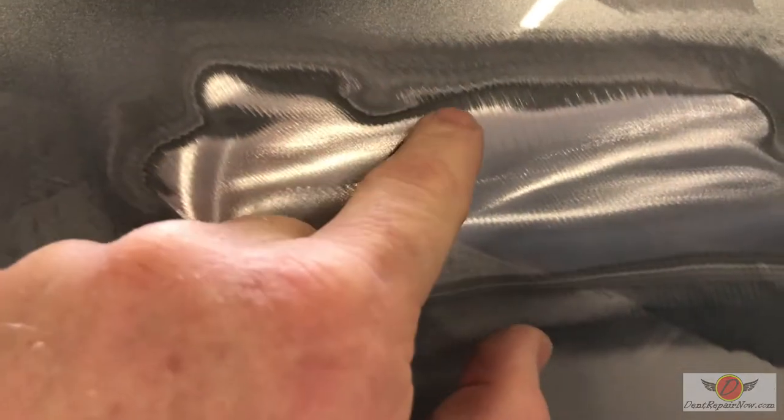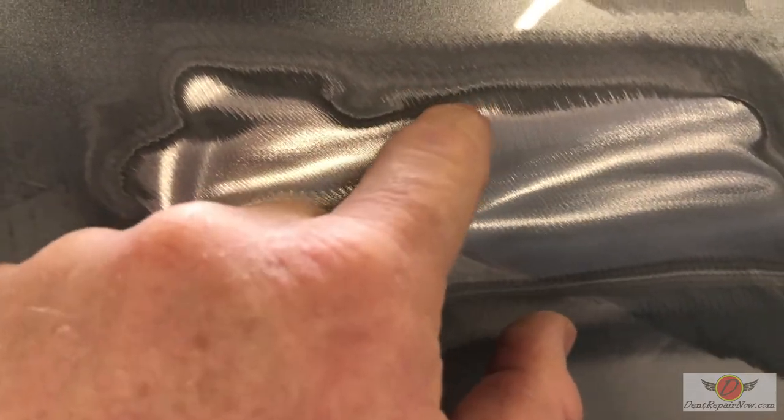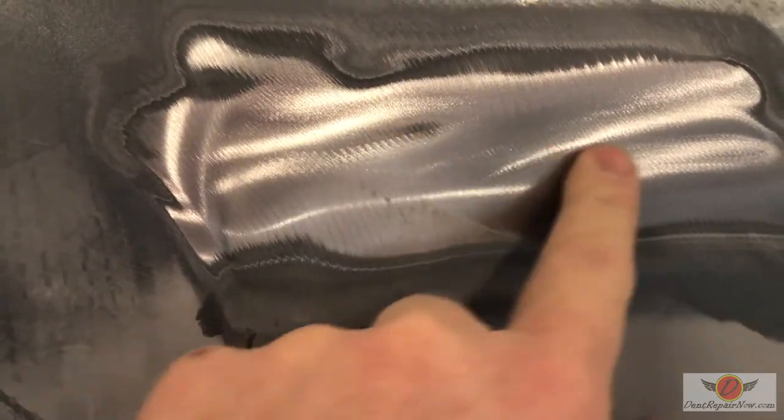While we're looking at this, you can see the shiny paint — here is your clear coat, then you've got your color, then you're down to your primer and then your sealer or e-coat, and then this is bare metal.